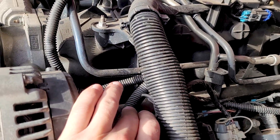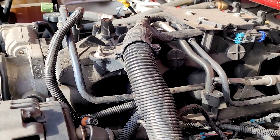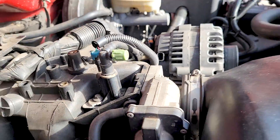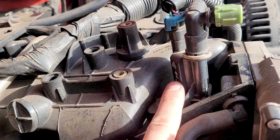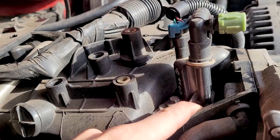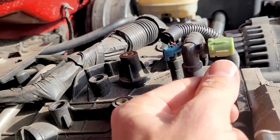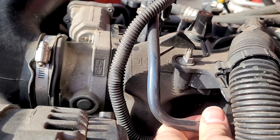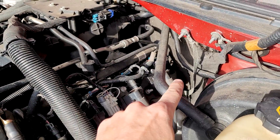Here's the intake manifold on one of these trucks — I have a lot of problems with these things. You have the throttle body right here with a gasket under it that can leak. We have the EVAP purge solenoid under here with an O-ring, and these little tubes with a cap on the end — it can all leak. You want to check these nylon lines here; they're hard plastic and go all the way down to the EVAP canister at the gas tank. Mice will chew them and put little pinholes in there — you'll get EVAP problems and never be able to find it.